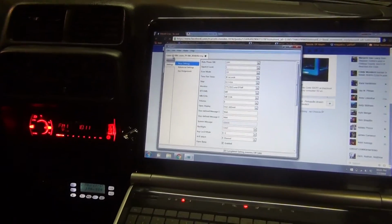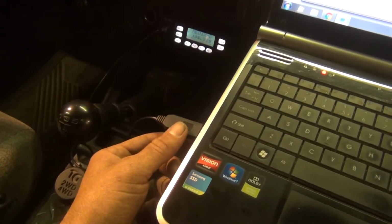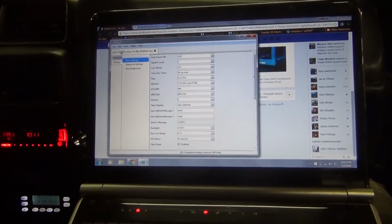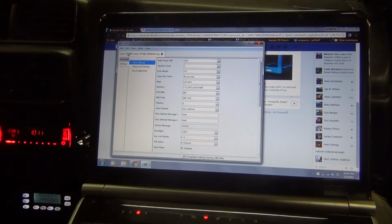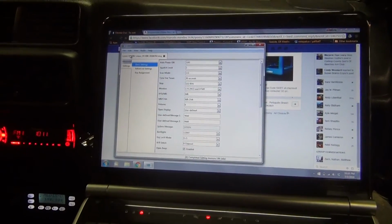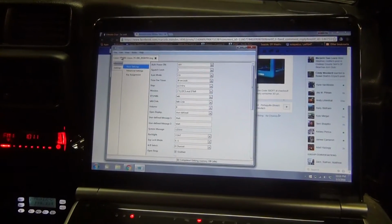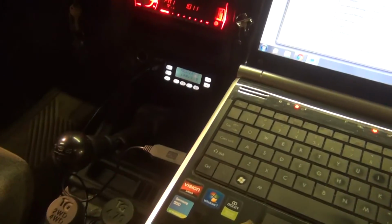Well, unfortunately, this has taken me an hour or two to sort out here. So it turns out the USB adapter that comes with this radio has one of the cloned Prolific chips in it. So the Prolific driver actually doesn't work with it. It recognizes it as a clone and then it disables it. So I've run into this before. I just had to download an older driver. I found one from 2012 and installed it, and that enabled the USB adapter there.